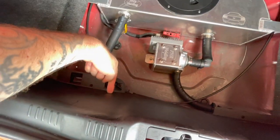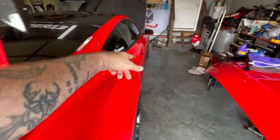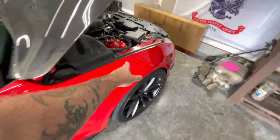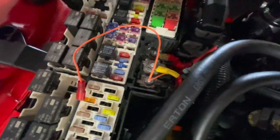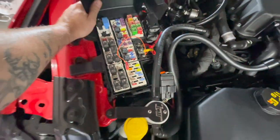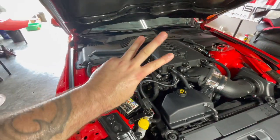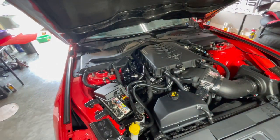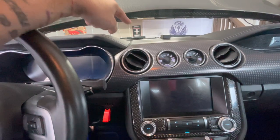This gives you three wires. Ground is going back to a factory ground back here. Power is going up through the car, through the kick panel, and into one of the hot sides of the fuse box. That orange fuse right there - you want that as close to your power source as possible, which is typically how you'd want to run an inline fuse. The third wire I've got going to a kill switch, and I want to do the same thing with my VMP triple-pass fan.